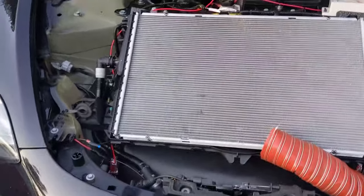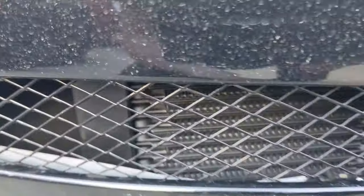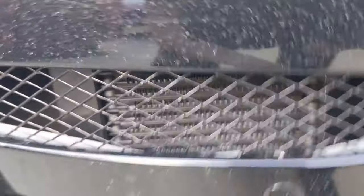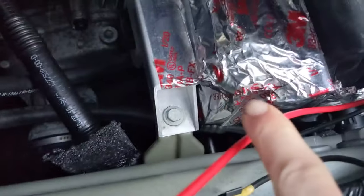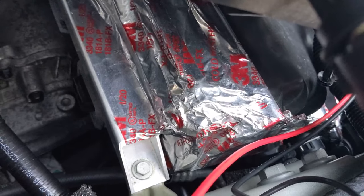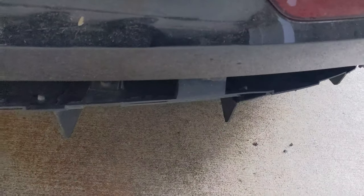Here's the cooling system in action. We're pulling air from the front bumper through the oil cooler — that's going to cool our front drive unit. We're pulling air through this radiator here, which will cool down our battery. And through here we're pulling air to cool both the battery pack and the powertrain cooling unit, which cools the rear drive unit.